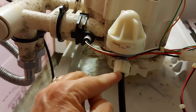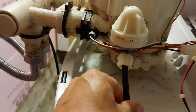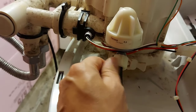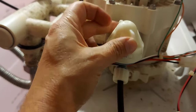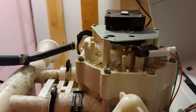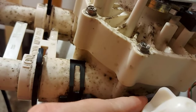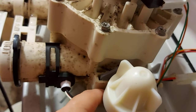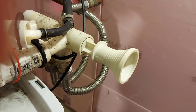Over here is another mechanism — this is the hose that goes into your float tube. This water goes to the float. I already took this off and made sure there was no debris, made sure it wasn't clogged — it looked clean. I took the top of this off and made sure it was clean. There's also a clip here and another clip inside that I'm going to take out and make sure this area is not clogged as well.